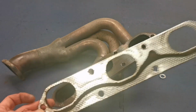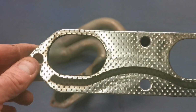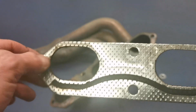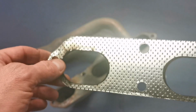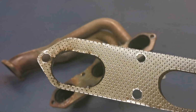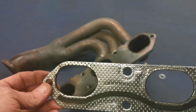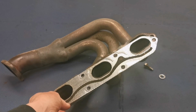So this is what's come off the car, and we can see his new gasket that he's replaced, and close inspection there. Well, this is the stud that's broke, so you can see maybe the exhaust gases are trying to get out there. So yeah, it wasn't going to do, and it won't do, so he's going to end up with the same problem again. That's quite fresh looking.